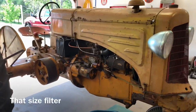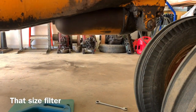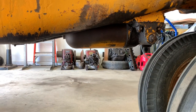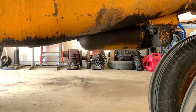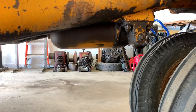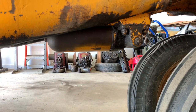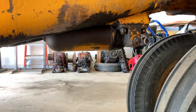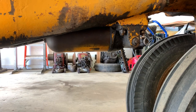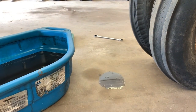On R's and Z's they have these filter shell style filters where they got a gasket on it and you have a filter that's submersed in there. Well, after years of people reefing on them, they drip. I think it's pretty hard to get a seal or a good gasket like this one I put together. Tightened it up, drove it around, got it hot a couple times as was breaking in the new rings and everything. Everything was good — got out in the field once, got it good and hot and, you guessed it, started dripping.